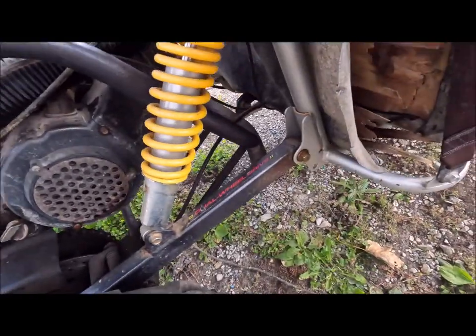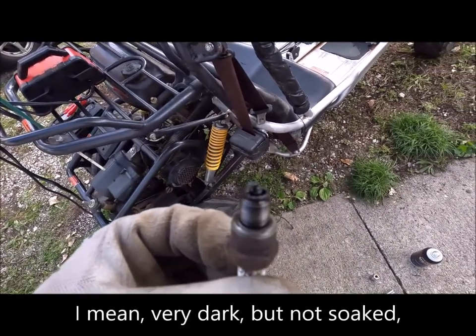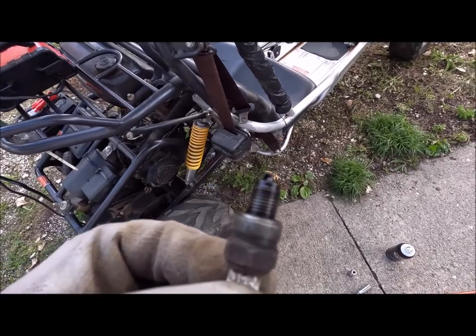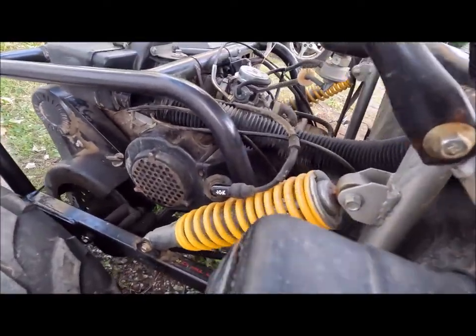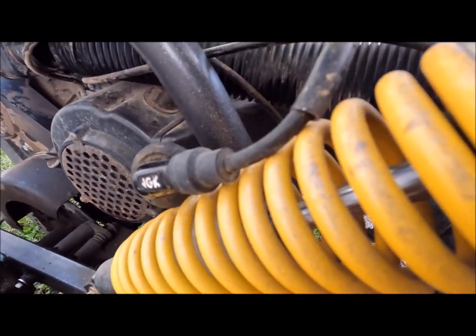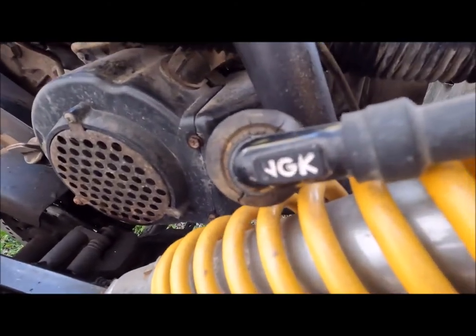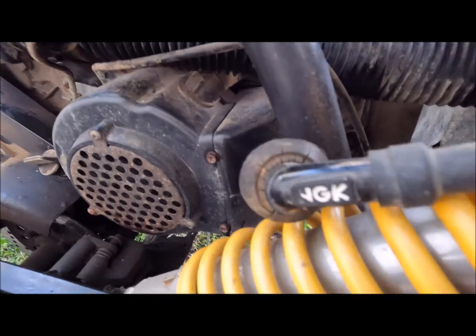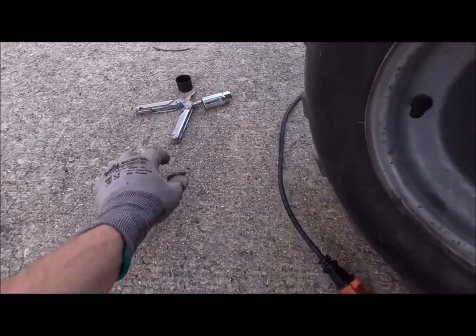Now I'm probably going to pull the plug and look at it. It is a little bit fouled. I'm going to torch this with a propane torch to get it dry and hot, pop it back in and see if it runs again, and catch how strong the spark is. Spark is good — it snaps, just like a good mower always goes snap, pop. I'm going to wire brush this plug and then dry it one more time.